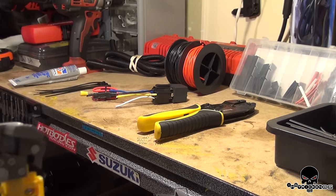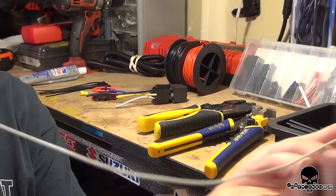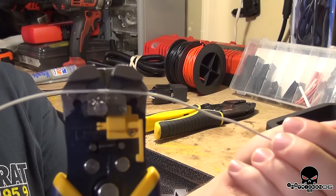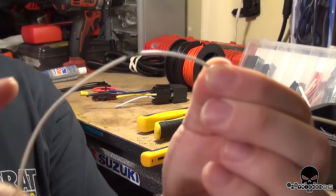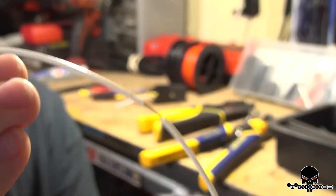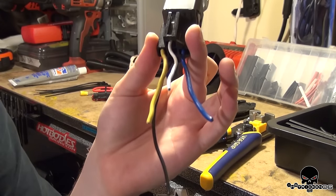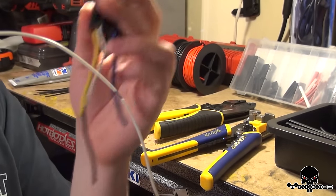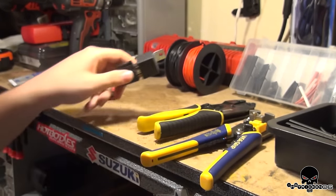I have some really high quality wire strippers that make awesome connections. If you have wire already installed in the car and you want to jump off of it, this tool can simply be installed right on the wire. Instead of completely shredding it, it will open it for you — a nice clean opening — so you can piggyback off of that wire and install your signal switch. As soon as the original fan starts to get power, it will give you the signal that you need.